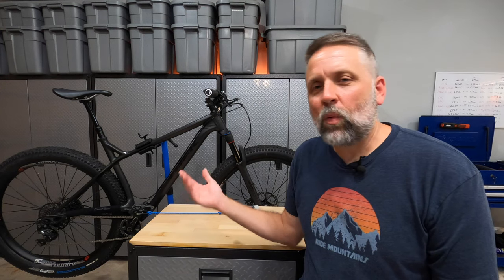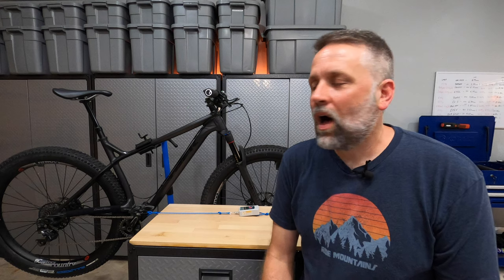Well there you have it. I tested squirt in a dry state as the manufacturer recommends, and ended up with a 1mm larger wear scar. I also think that squirt makes your chain stiff and introduces chain drag. I might have worked it out by riding the bike for a few miles, but I'm just not impressed with wax's performance and protection against wear. I'm going to change this bike out to a single speed, and when I do, I'm going to use a different lubricant.